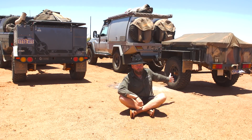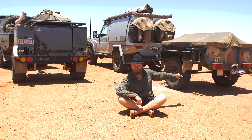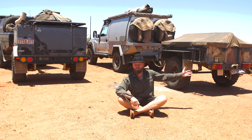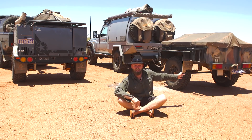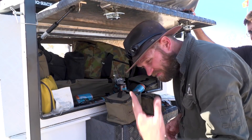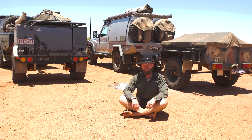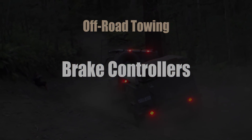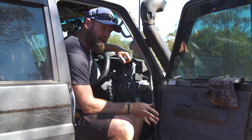With leaf-sprung trailers, as long as the suspension is soft enough it's fine — if it's too rigid it's not good. If you hit things hard off-road with too-stiff suspension your cargo is going to suffer and the leaves may break, putting a lot of stress on your trailer. If you have a very light trailer with stiff suspension you've got to put weight in it. And if you're a company making off-road trailers with leaf springs, for crying out loud put some shock absorbers in them.